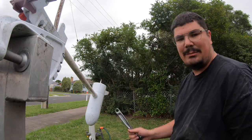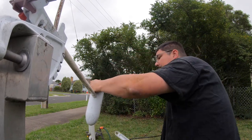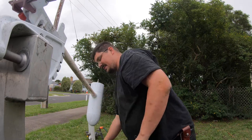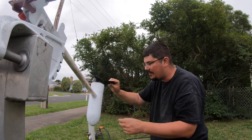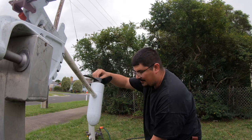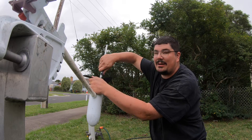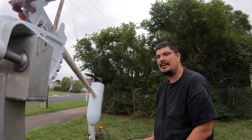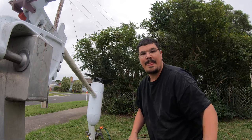I'm risking bending it off, so I'm going to try percussive maintenance. That's looking a little bit straighter — straight enough for me anyway. I'll put the prop back on and hopefully not lose the gudgeon pin. This prop has grounded out a couple of times — it's about 30 Aussie dollars for another one, so we might find a replacement at some point. I do have a proper spanner for this under the seat, but we'll just whack it back on like so. Crisis averted — hopefully I haven't chewed up the rubber seal too much to cause leaks.